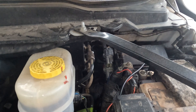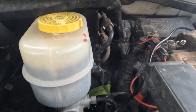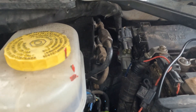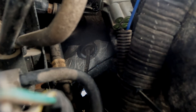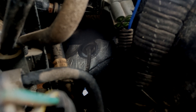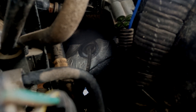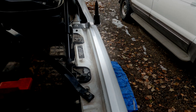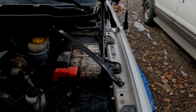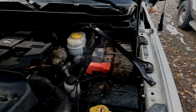On these RAM 2500s, another question I get all the time is how do I get the coax cable through the firewall? It's different for every vehicle, but on these RAM 2500s, right there in the middle of the frame — that's where the cable for the emergency brake passes through. So we're going to nick a spot right next to that and then pass the coax cable through right next to the emergency brake. Get on forums and find out the best way for your specific rig.